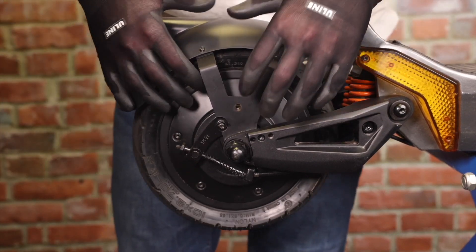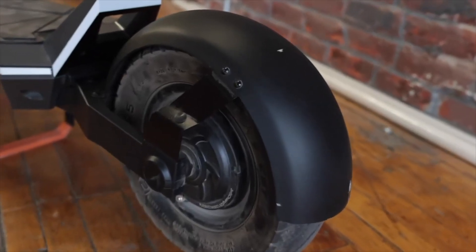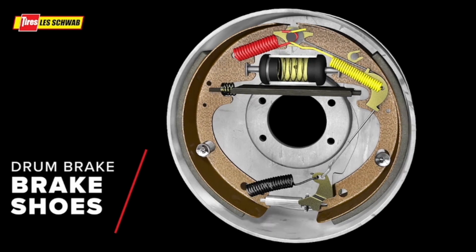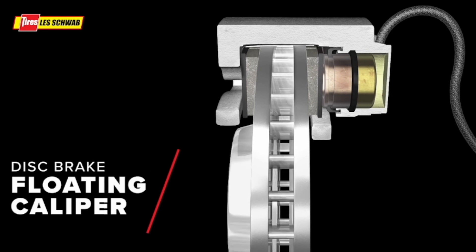So then we decided to change to drum brakes — this is what you have on the New City and on the Apollo Pro. Drum brakes are great because they're fully enclosed, so they are protected from water, dust, dirt, from everything pretty much. The brake pads are a lot thicker, so they're going to last much longer — maybe three to four times the lifespan of a disc brake. In theory, it doesn't brake as sharp as a disc brake, but you can still lock the wheel with a drum brake, so it really depends on the traction of the tire more than the actual brake pads.